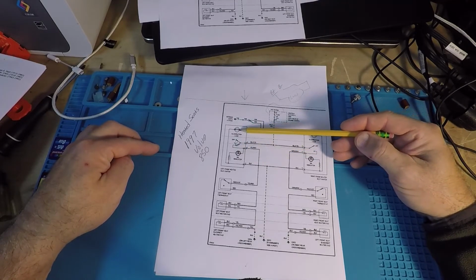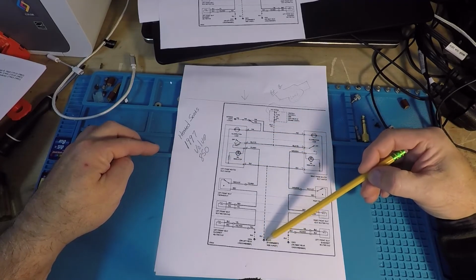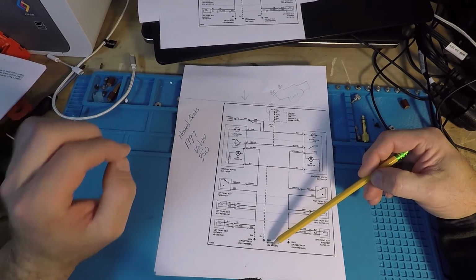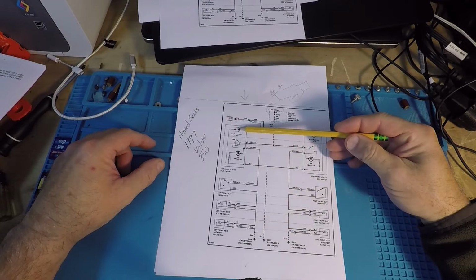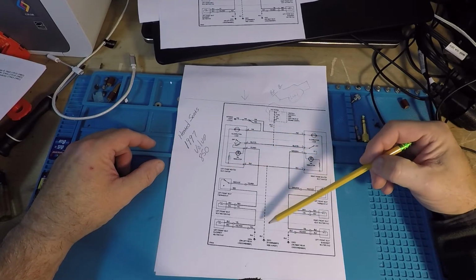So the illumination light is on a wholly different circuit. They both share the same ground though. And we can talk about grounds forever because that often is the big thing that gets everybody when they're diagnosing something. So, switch is on, LED's on, going to ground, the illumination lamp's on, it's dark, and the light comes on with all the interior lights, and right from there.